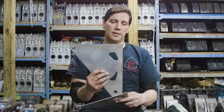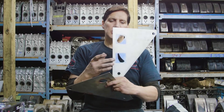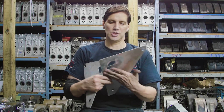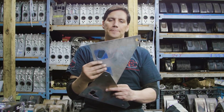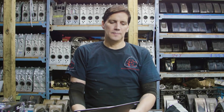This template I have in my hand is a standard template that you can buy from RacingBeat. It's a slightly modified exhaust port with the primary port on the same template, and then their template is actually just a secondary fifth and sixth port like this. We are going to do the upper and lower ports on the outside plates. This video will actually be of interest to anyone who owns a 1984 to 1992 non-turbo six port motor — stand by and we'll explain why.